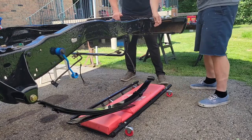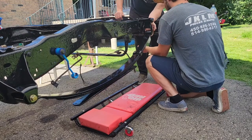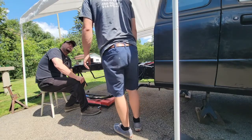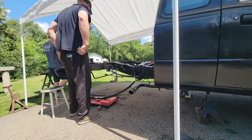He put a lot of work into this thing — he cleaned out the entire frame, got it right down to metal, then did a rust encapsulator because it's an old truck that sees a lot of winters and is going to see many more. Then he painted over top of that, and I think he did an excellent job. Frames always seem to have a really rough, bumpy finish no matter what you do, but every component going back onto this thing looks really, really good.